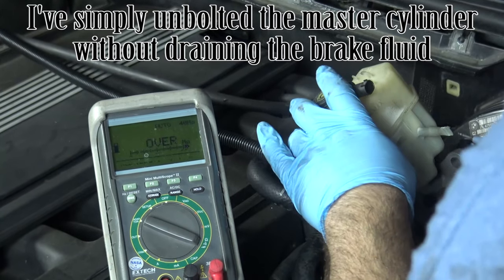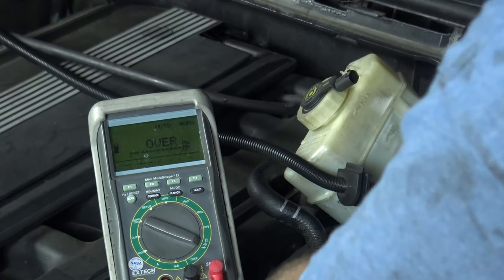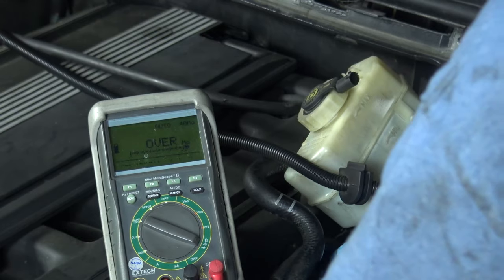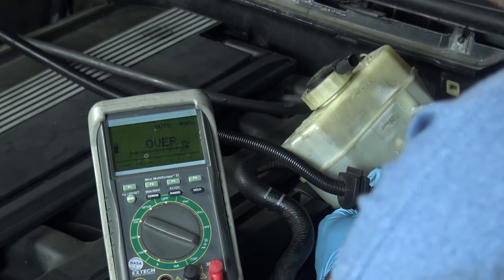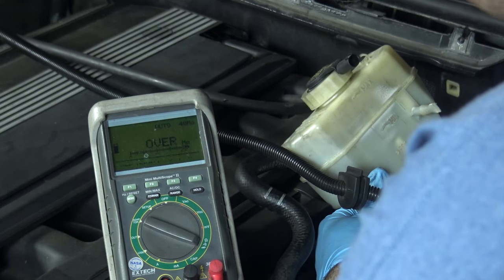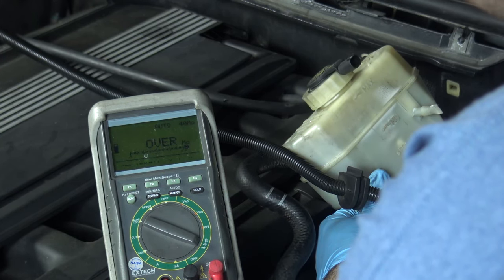This sensor reads 45.6 kilohms. So around 45,000–47,000 ohms is what I'm looking for. I would say if these two junkyard sensors are to be trusted — which they probably are — I'm assuming I'll get that reading on a good sensor and something wildly different on a bad one. Let's change the setup and move over to the sensors on the car, though it's at an awkward angle.